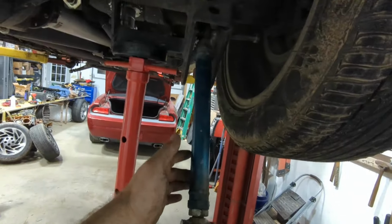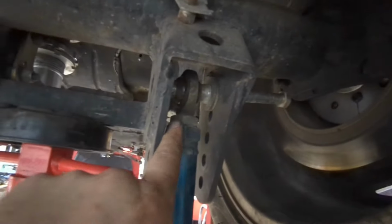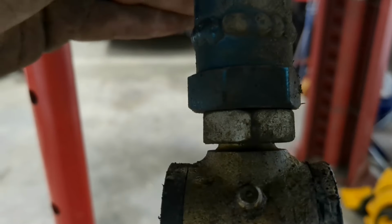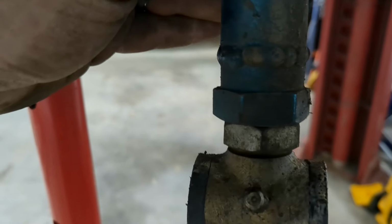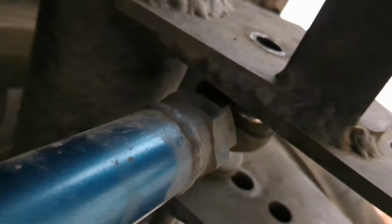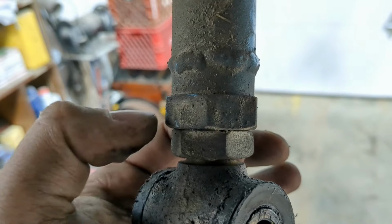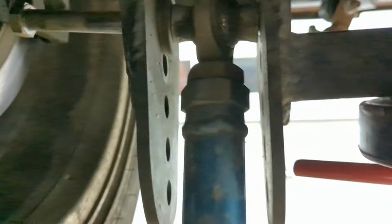Okay, I'm popping these control arms out because this heim is making noise. It's terrible. And also because I wanted maximum thread engagement on here, and I pretty much did that. This is adjusted correctly in the wheel well. But the problem is when these are installed, you can't get to the jam nut in there. You can't get a wrench on it. If I just lathe off the hex on one side here, that'll give me half that much thread. And I really don't need much in order to get to that jam nut, so I'll be good to go.